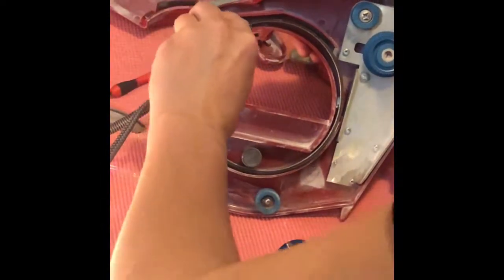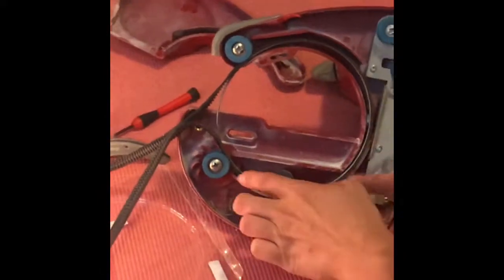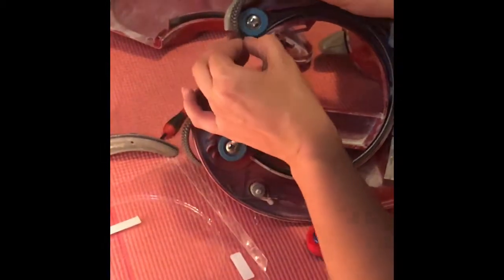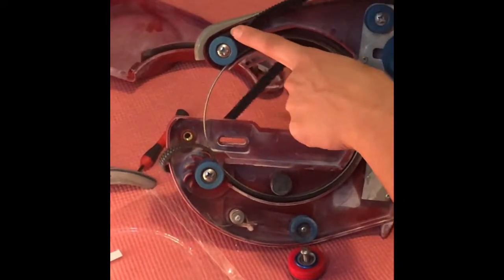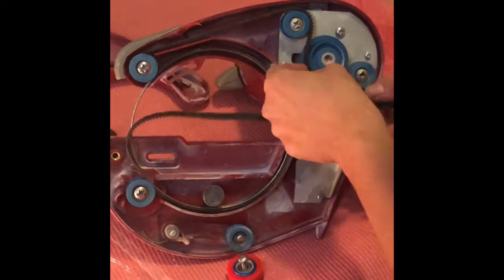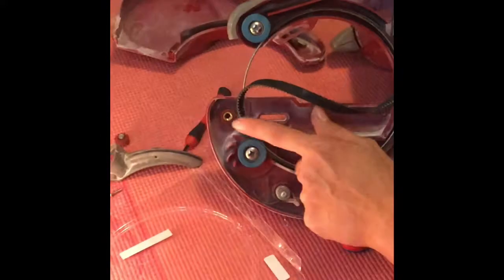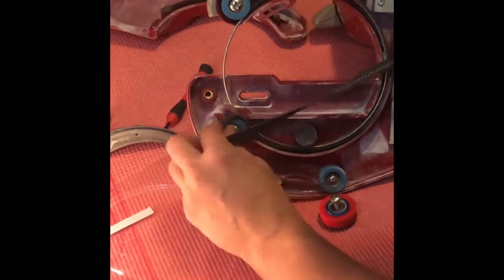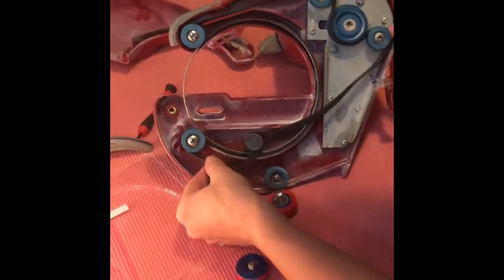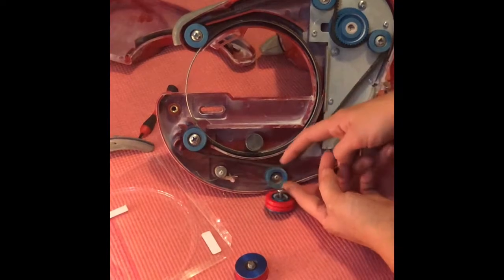Once that's tight, it'll let you know when it's tight — there's no over-tightening these. Now once that's in place, make sure it's all tight all the way around. I'm going to take this belt and wind it around. Once that winds around this bearing here, I'm going to wind it with the teeth facing outward, and the teeth line up with these grooves here. Around the next bearing — and that's how you wind that. This one here from the front goes around the bearing. Just like that. And then the very last one, the spring-loaded one — you move that up and then stretch it around.